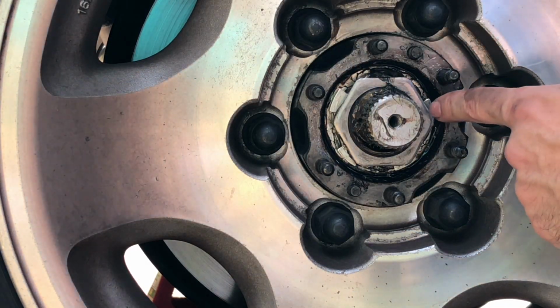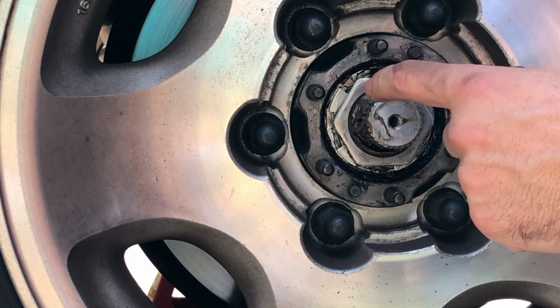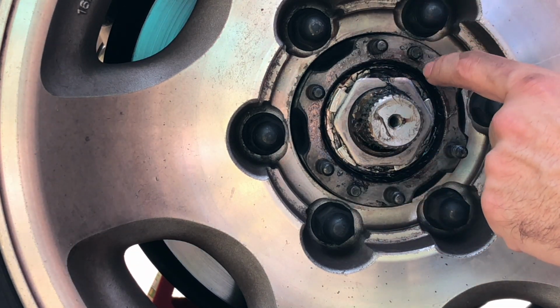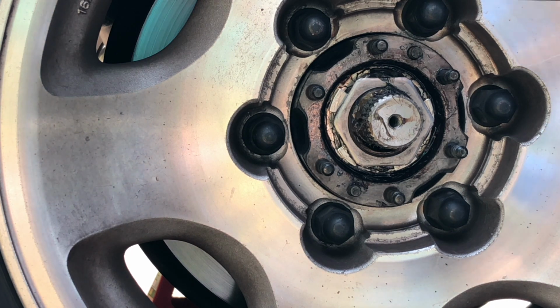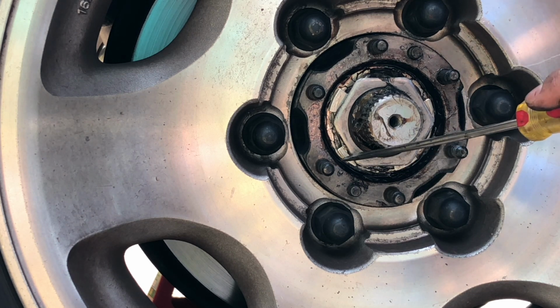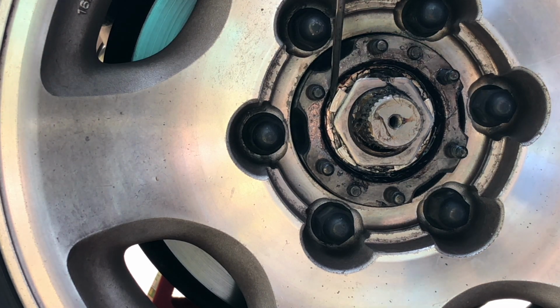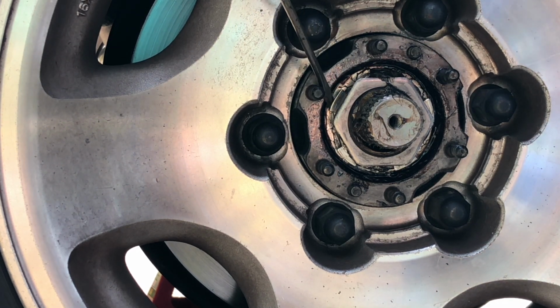Okay, so the second nut you put on after you put the star lock washer on, and once you got that on, you just snug it by hand. You don't have to be super tight. And right here, I bent one tab forward towards the inside to lock the inner nut. And then what you're looking for is a tab that's on a flat for the outer nut, and that one right there is what we're going to go with. So we're just going to take a screwdriver and bend that over like that.